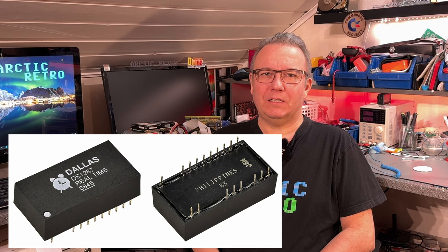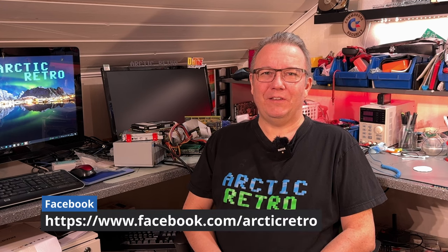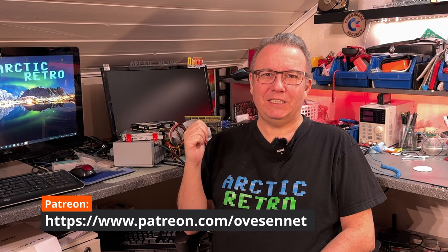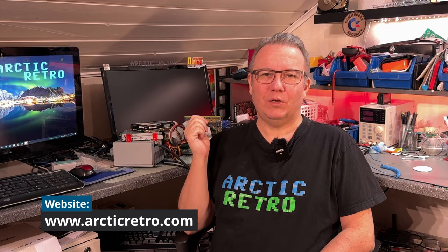It kind of works, but it has one of those Dallas real-time clock chips, and of course those have a battery built in, designed to last at least 10 years. However, some of this stuff is passing 30 and 40 years. The motherboard won't save its BIOS settings — you can save it and if it boots again it retains them, but whenever you turn the machine off and on again it is lost, because the battery inside the real-time clock chip is totally empty and cannot be charged.